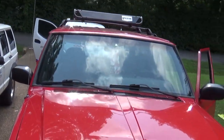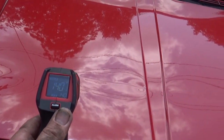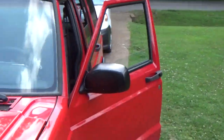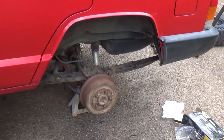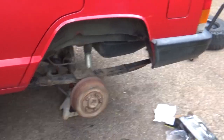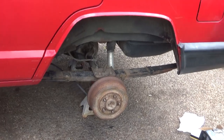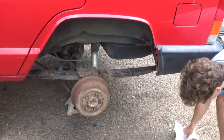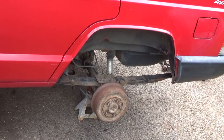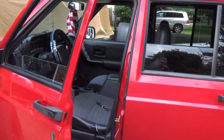Thought we'd look at the temperature — hood of his truck: 140 degrees. So it is warm out here. On this brake job, usually what I do at this point is hit the brakes a couple times, take the drum on and off, make sure that it's good and tight going on, and then the self-adjusters should take it over from there. We're going to throw all this junk away and get a whole brake kit. We were into this brake job for a total of $35 with turning the drums, shoes, and the hardware kit. Because we didn't lose any fluid, I'm not going to bleed it and the brake feels really good. But you can bleed the brakes if for some reason your cylinder leaked a little bit of fluid — this one didn't, so we should be in good shape.